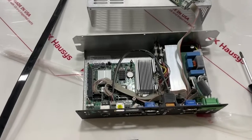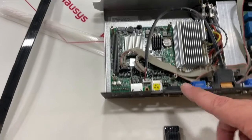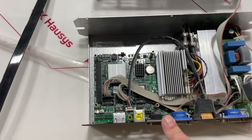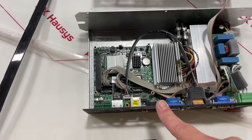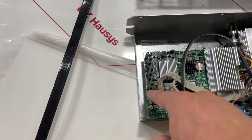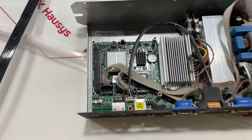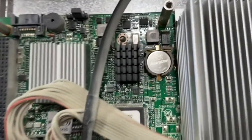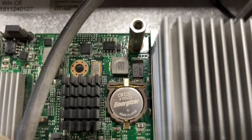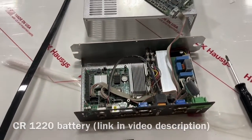The cover's off — it just takes a little bit of prying. You might have to pull back a little bit on this faceplate. I also had to remove that black connector that was sticking out. Pull back here and then everything else should be free to pull up. It just disconnects off of these pins that were sitting in here, so just be careful with that. And now we can see our battery right there — the Energizer Plus 3-volt lithium battery. We're going to pop that one out, put the new one in, and then we'll be ready to start putting this back together.